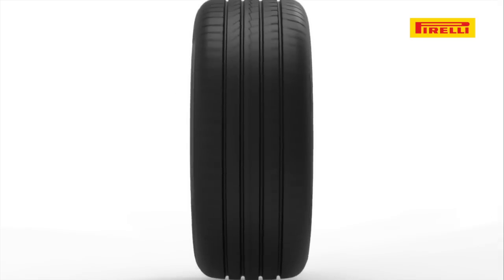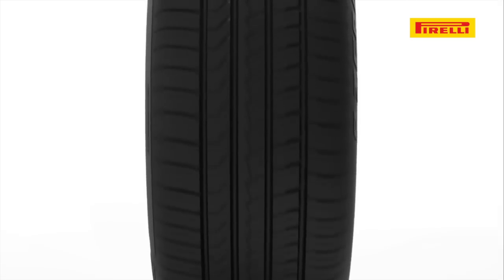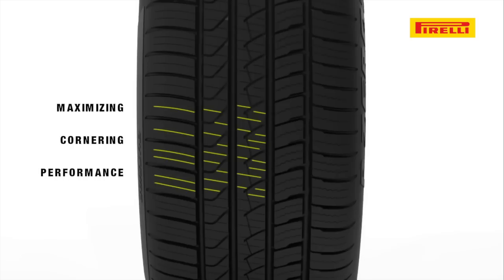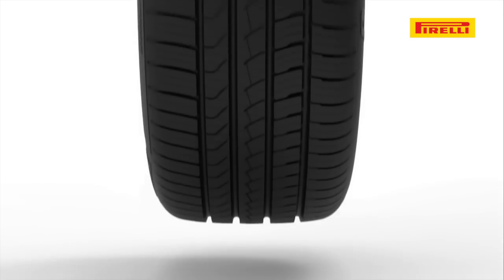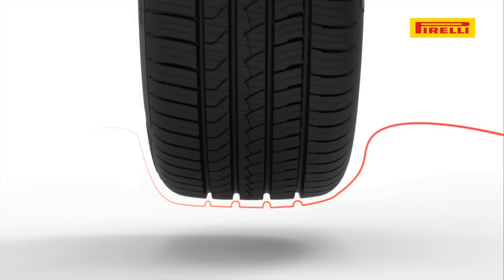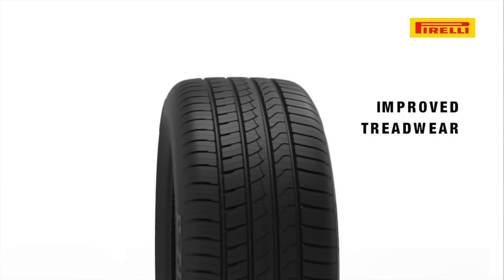The technical features of the tire's tread pattern, such as the tread block stiffness, lateral siping, winter siping technology, and optimized circumferential grooves all play important roles in the tire's performance. The overall shape and structure of the tire are designed to create the optimal contact patch of the rolling tire on the road surface, resulting in improved tread wear and better mileage.